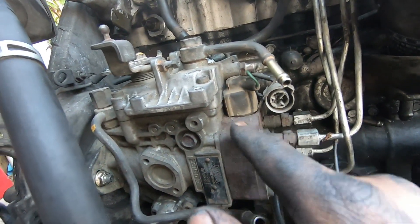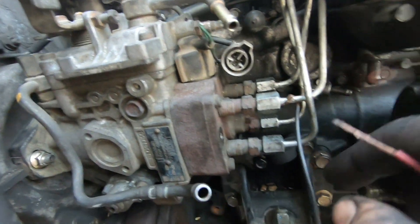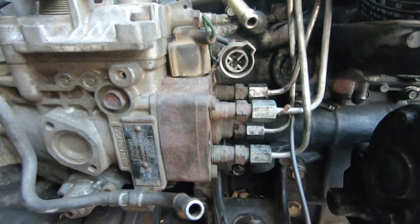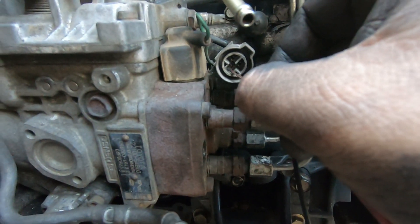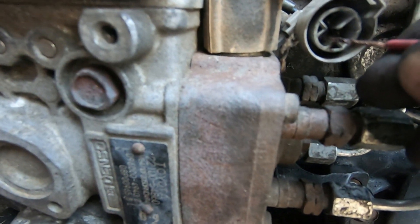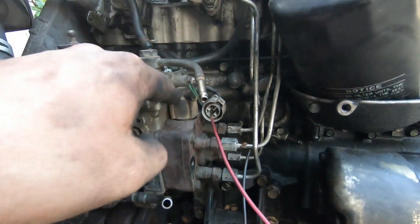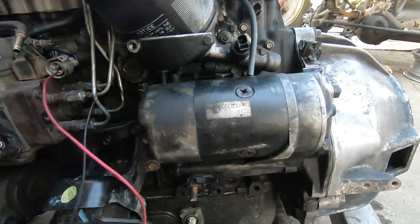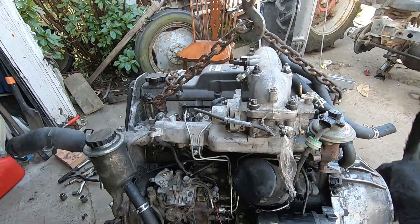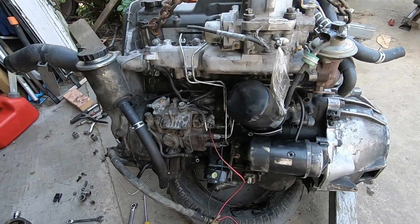The fuel solenoid was very easy to find. On the injector pump it's basically just the back one right before the fuel lines — makes sense. I followed the green wire to the plug. There are three wires in there. I ran my earth from the car battery charger just wrapped around one of the injector pump lines to ground everything. I prodded the terminal on the green wire and if you listen carefully you can hear the clicking of the fuel solenoid. So if I just run 12 volts to that, the solenoid should be open. Now I just need to run fuel to it, connect a battery to the starter motor, get it to crank over, and it might try and fire.